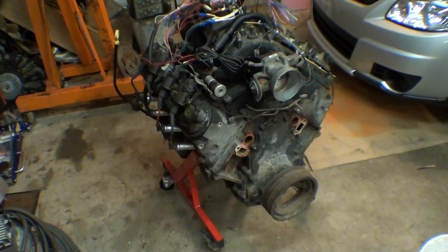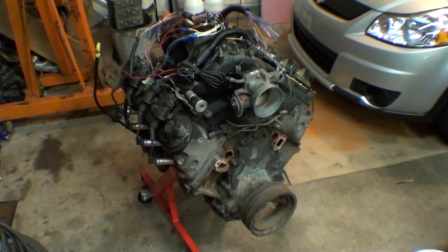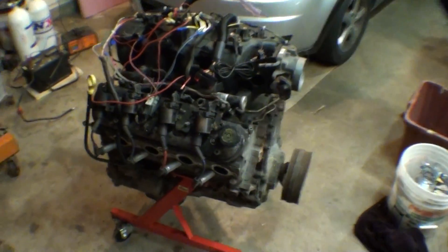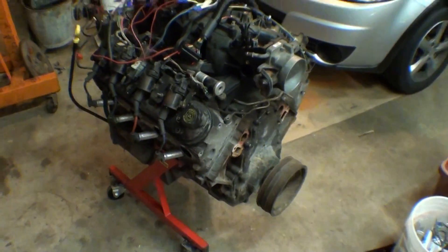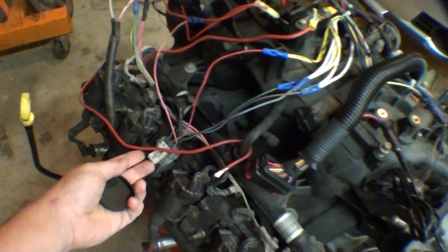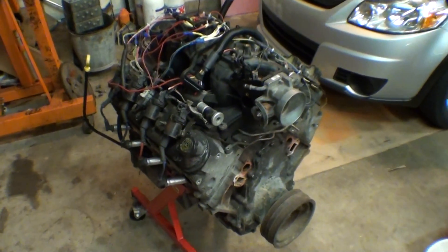So that's just something neat. Hopefully I can get that going in maybe a week. I'm going to buy some more micro squirt stuff. This week, if everything goes good — I've sold a bunch of them and people have seemed to like them so far. I'm not the prettiest wiring person, but maybe I should just leave them unmanaged so people can loom them themselves. I'll mount the ECU right to the intake also, and then we should be able to start the motors on a stand. I'll make everything so that it's pretty much — you just unplug the coils, the crank position, and the coolant temp, and you should be able to lift the whole ECU and wiring and everything out with the intake. Then just slam it on another motor, hook it up, and you're ready to go.